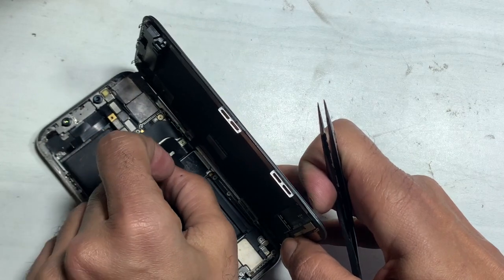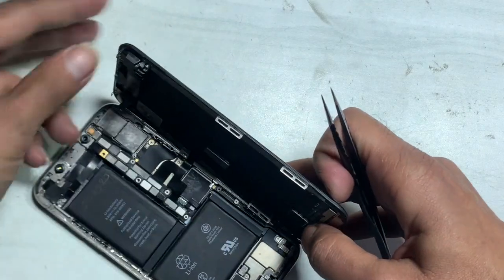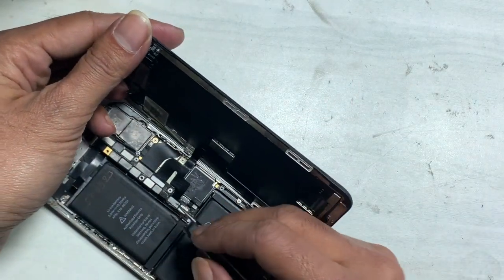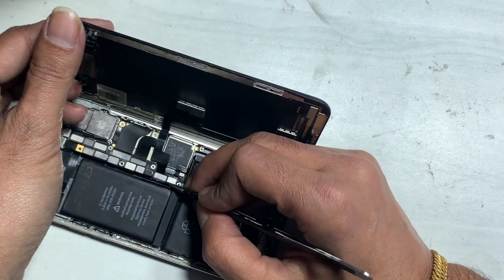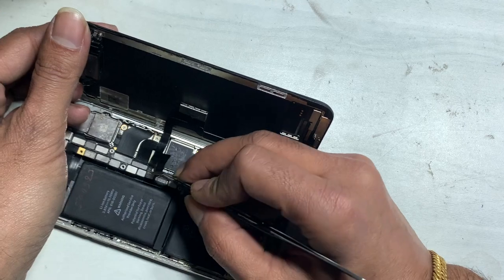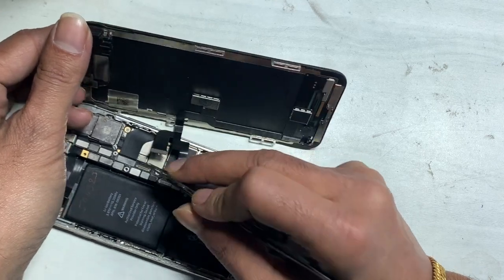You have to disconnect the battery first while doing any hardware job or disassembling the iPhone. Otherwise, the dot projector module on the iPhone might be damaged by static energy produced by our body.